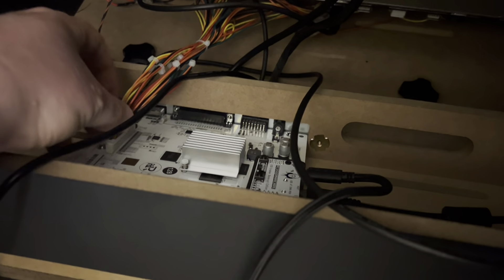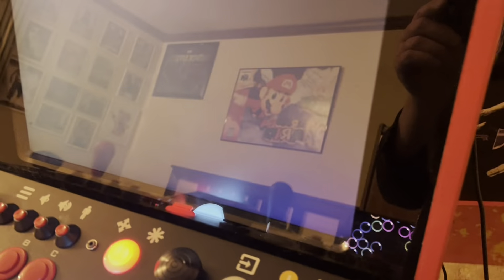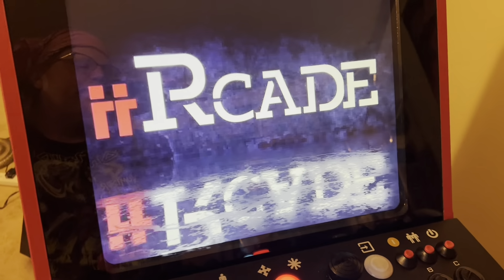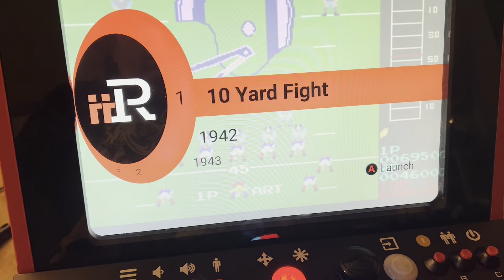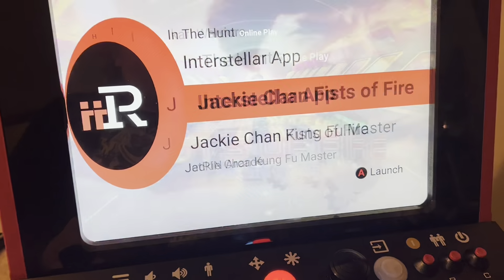I'm going to test the buttons first, then put the glass back in obviously. You'll see I plugged the deck back in. I'm totally unplugged from the wall — you do not want this plugged into the wall while you do this stuff. Okay, we're cutting on. I'm pretty confident this is going to work, so I went ahead and screwed the deck back in and put the glass back on. Normally, for most people, I recommend testing it before you screw everything in, because it's just an extra step if it doesn't work. What I usually use to test is Street Fighter, because it's got six buttons and I got six buttons to test.